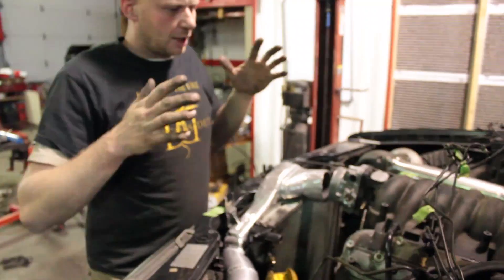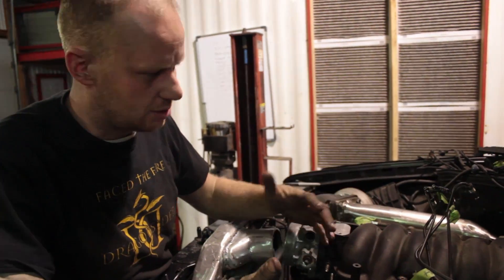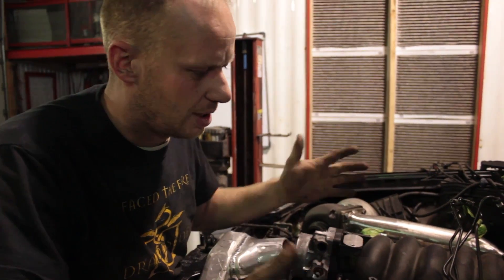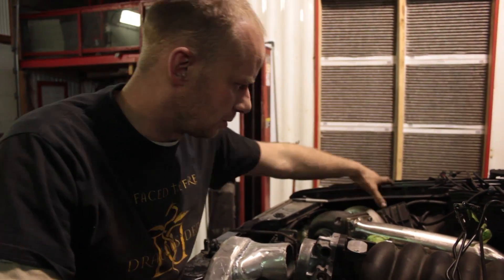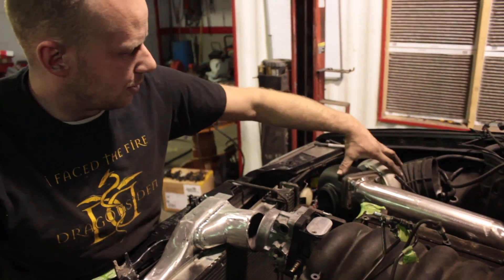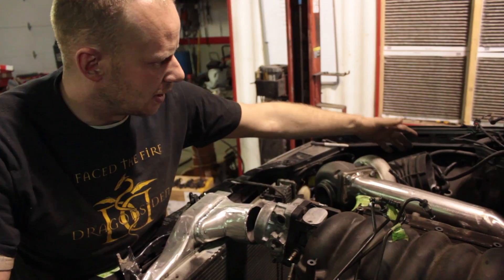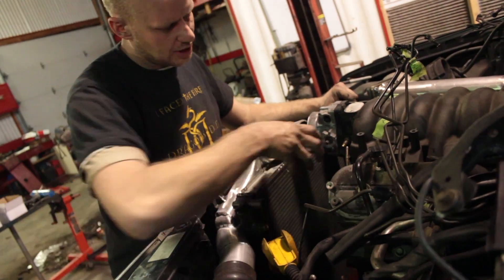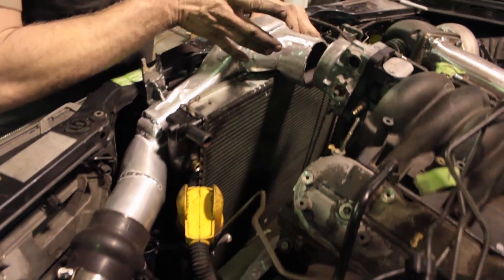Basically I got to start with things I can't change. The exhaust — it is where it is. I can't change anything except to a certain degree. The turbo is a big unit. Got to make sure I can fit an air filter in this corner and that the exhaust kind of goes down. I would have liked to angle it more, but what I gain on the exhaust I lose on the intake. I didn't want it coming straight from the side — kind of ugly — so that's why we made this and it kind of tucked around.